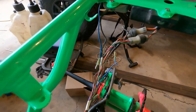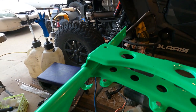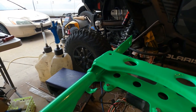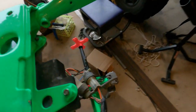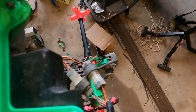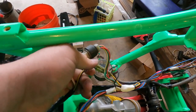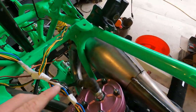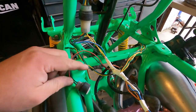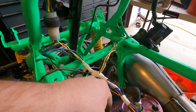And then at the back, you're going to have your voltage regulator here, ground, voltage regulator plugged in there, and then your two plugs for your CDI. So CDI, voltage regulator, stator, your coil, your kill switch, and your key switch. With all those plugged in, hooked up to the handlebars where they need to be,